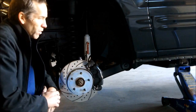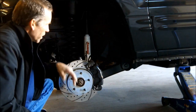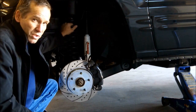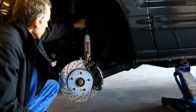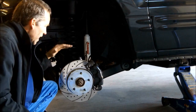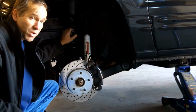You're going to want to start by raising your vehicle up, and I'm doing it on the frame. Right now I've got it on the transmission crossmember, and remove your tire. Do not put it on the axle, because I want to get as much of this tension off of this spring as I can. We're also going to disconnect the shock and probably the sway bar. What I'm trying to do is get the axle to drop as much as I possibly can. And hopefully I don't even need a spring compressor to do this. I brought the spring compressor just in case.